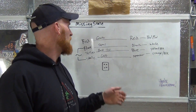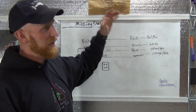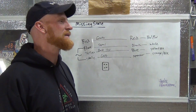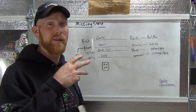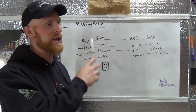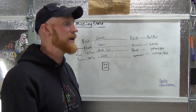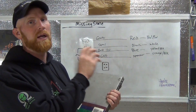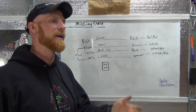I'm not talking about the oxygen sensor signal like it's supposed to do at idle between 0.9 and 0.1 volts. Your computer basically runs the injectors so there's a little bit of a rich condition, so that it goes between rich and lean, staying in stoic at around 450 millivolts. This is so you have some fuel hitting that catalytic converter to keep it warmed up quickly and then maintain that temperature.